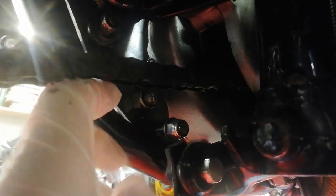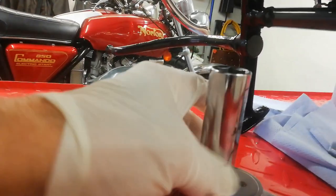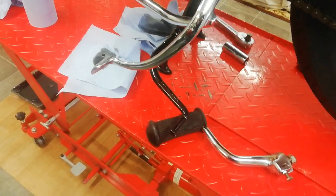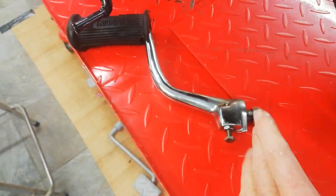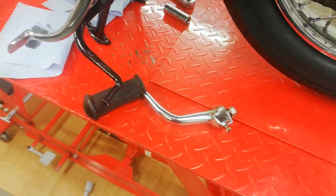There's a big nut right behind the chain that holds the foot peg on. I put my gloves on — a very good idea because it's horrible behind there — loosen the chain because you can't get to the nut otherwise, then I can get my extended socket on it, move the chain out of the way, and remove the foot peg. There we go — foot peg's off, and that's the nut from the inside. As I said, the easiest job is always the hardest.